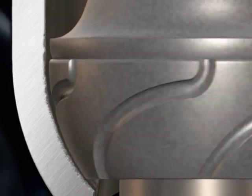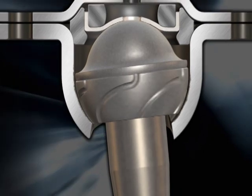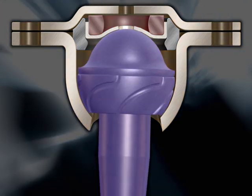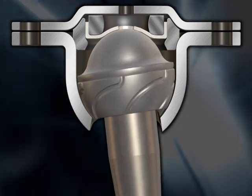Another shortcoming in the competitor's two-piece stamped housing is that the design leads to end play. The two-piece stamped housing, bottom seat spring, powdered metal bearing, and ball stud have combined stack-up tolerances that create more opportunity for end play.